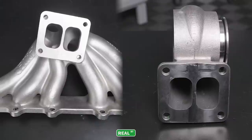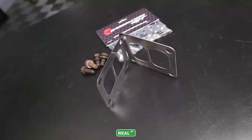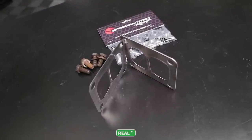If you're going to use a multi-bolt flange to hold the turbocharger to the exhaust manifold, here are some things you should look out for. That flange on the exhaust manifold needs to be perfectly flat and you should check it before you start the installation. If that flange is not perfectly flat, you're going to have problems with leaks, and with a divided housing I've actually seen the gasket break in the center and go into the turbine wheel, damaging the turbocharger. Make sure that flange is perfectly flat and use quality hardware.